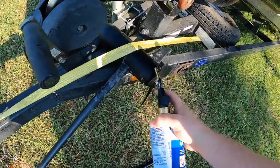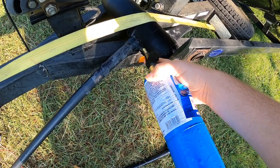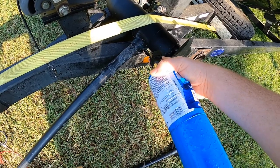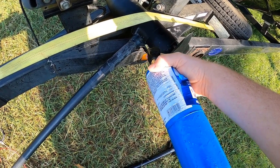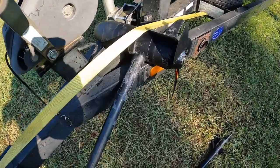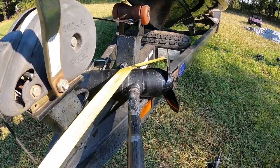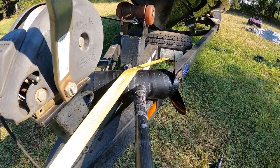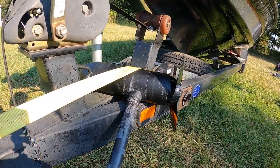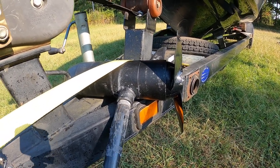Then you've got to take a torch, or use some method to heat right here just around the little metal part on the foot where the shaft screws in. There's some kind of lock tight, some kind of sealant inside of there that you have to use the heat to break loose. Once you've got it sufficiently heated, you should be able to just twist — that shaft should start to twist and you should be able to twist it out. I'd recommend holding it at a downward angle, as there's some debris falling out and you don't want that falling inside your foot.